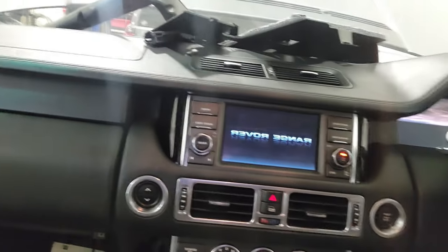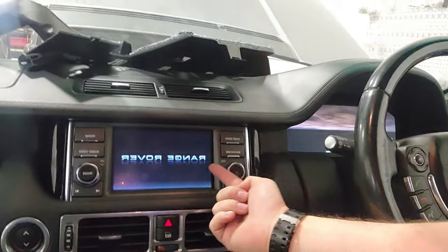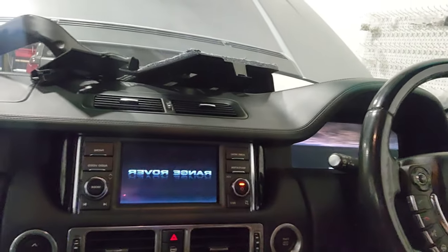We have nothing but crazy headaches going on at the shop. I'm in a 2012 Land Rover — surprise, surprise, Land Rover. Any of you familiar with Land Rover products know that the blinky light and stuck 'Range Rover' message on the dash means we have an open in the MOST bus.